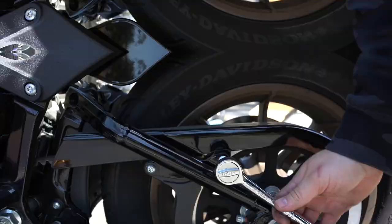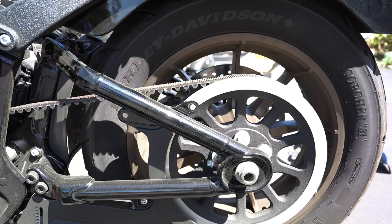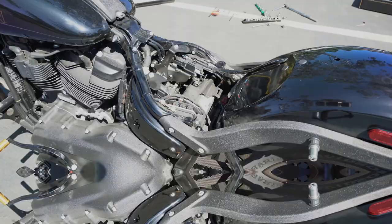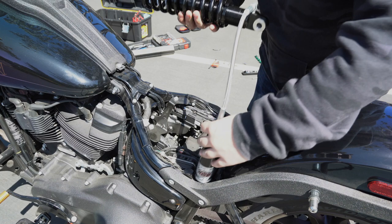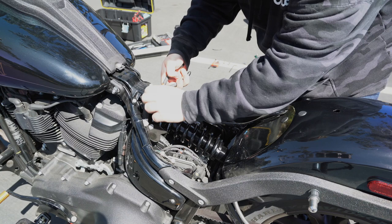Next, you'll want to install the bracket to hold the RWD shock remote reservoir. To do this, you need to remove the belt guard. I know some people worry about removing it, but unless you're riding on really gravelly road, you should be fine. Plus, I might end up doing a chain conversion anyway. After you've got the bracket loosely installed, feed the remote reservoir between the fender and the frame so that the line sits on top of the swing arm. Put the remote reservoir into the bracket and position the new shock's top eyelet into the top mounting hole, then loosely put the top bolt in just enough to hold the shock in place.